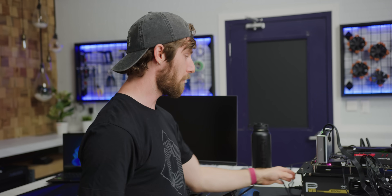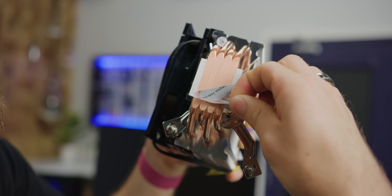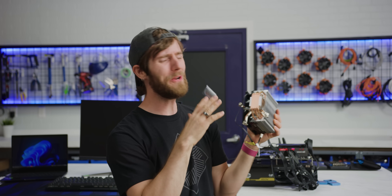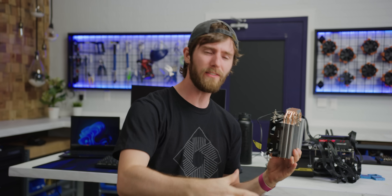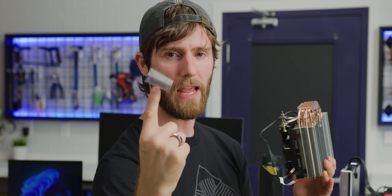You can see it's powering on just fine. But what it is, is a silent performance killer. I didn't peel the plastic off the bottom of my cooler. You might say, not me — who could be that stupid? I thought like you once until one fateful day, even though I had years of PC building experience, I was in the middle of a build, got distracted, pulled away, came back, carelessly put it together — and pow, plastic between my CPU and my cooler.